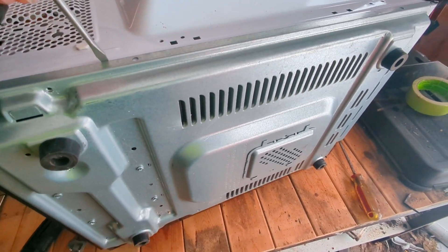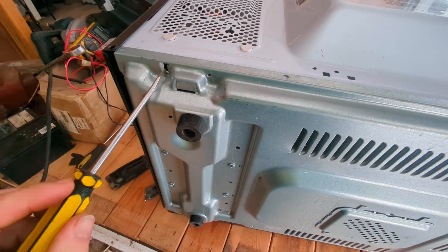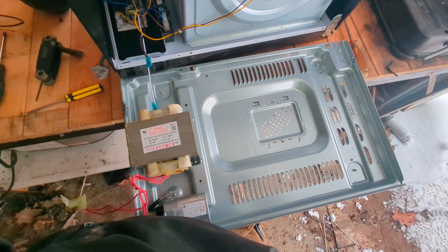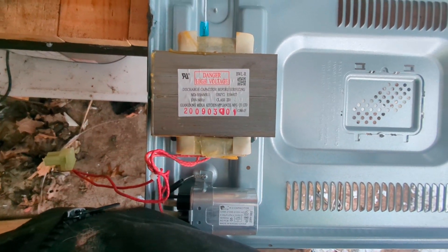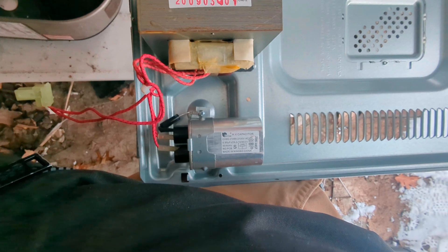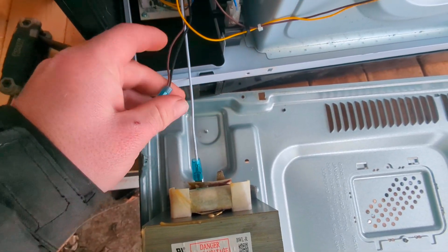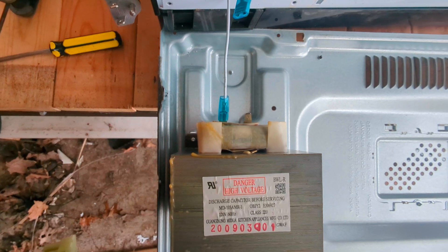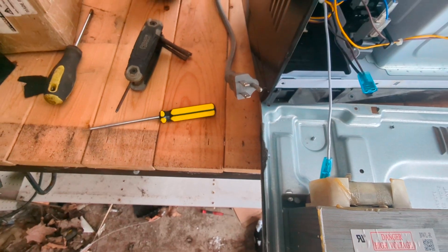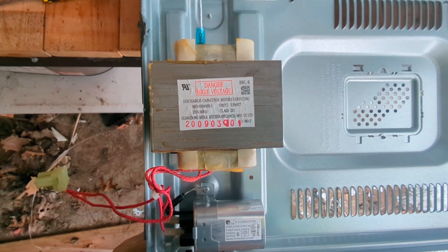Prying the bottom off shouldn't be all that difficult. I'll be right back — I think I need both hands for this. Okay, I got all that pried off. This is the part we're looking for. Discharge capacitor — those things hold a lot of voltage, so you don't want to just grab this stuff without making sure it has been sitting for a while with no power to it. I also try to remember which wires went where, because we need those. This here is going to be our ground, and that should be our power. We're going to need to know that when we wire in our plug. We don't need the control board or anything back there — we just need this.